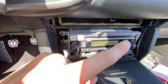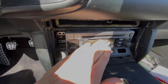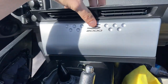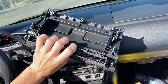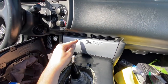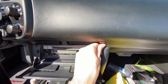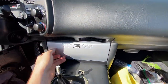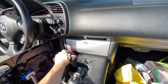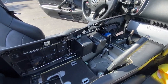Now what I'm going to do is put back those four screws and start to reassemble. All of the Phillips head screws are now properly in. I'm going to push this back in, making sure that all of the clips are properly in. It's actually easier to put back in than it is to take it out. You just want to make sure all of the clips — give it some push, give it a couple bangs here — and just make sure everything is back in. Give it a pull to make sure all the clips are properly fastened. Now I'm going to go ahead and put this back in and just make sure that the wires are coming out neatly and everything's going in correctly.